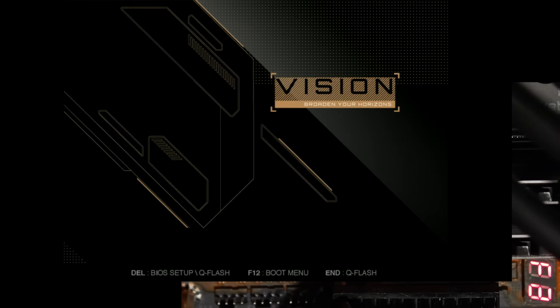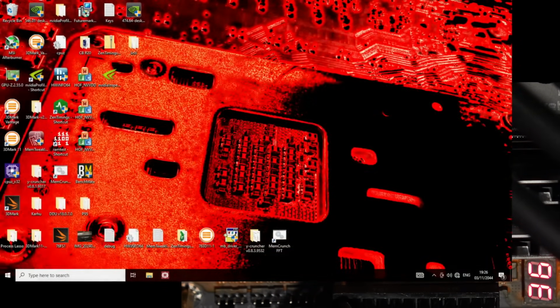do the custom P state thing because I think the PCIe or the memory controller or something starts to break, because booting up gets really random. Sometimes it'll post, sometimes it doesn't. And the memory overclocking with a hefty BCLK overclock gets very wacky. And then there are no curve optimizer settings. You do have PBO, but you can raise the power limit, but the CPU isn't power limited. So that's not going to do anything.